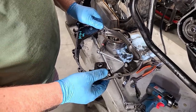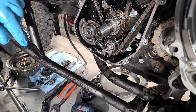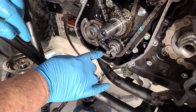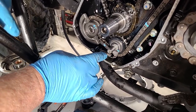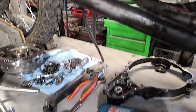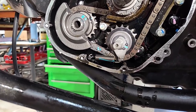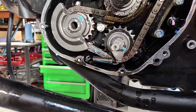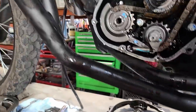This area is now beveled compared to the old days. The factory extension spring used to rub grooves in it. You can see that as this lever moves just a little bit, it would be completely out of tension. There's a little bit of space in the coils at one end, but at the other end there's no space — maybe 15–20 thousandths. This is the factory spring, and look how it's really not providing enough tension. As the bike ages and the chain stretches, it won't be able to tension the chain at all.